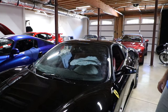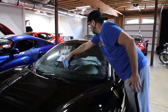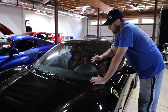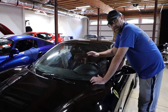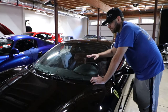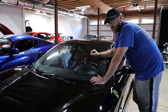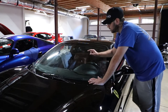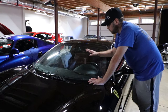Splatter is so much fun to get going. All right guys, I had my doubts but I can tell you that I spent on and off about an hour. What I would do is polish it and then wait because it would get hot — I didn't want to risk any cracking. Then I'd come back and do it again for about five to ten minutes. The nice thing is you put on the material first, get that coating going, then add a little water. The water makes it messy but it helps cool it off and also seems to make the product work even better. The application first and then a little water helps lubricate, keep everything cool, and make a difference.